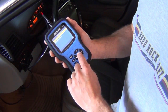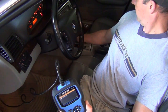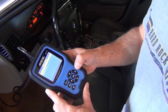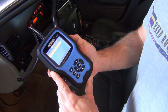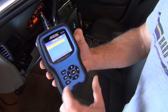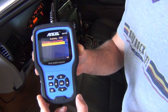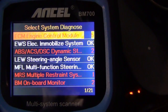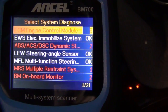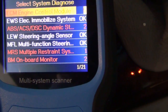We're going to do basic functions and let that communicate. Let me turn the blower off so I'm not draining the battery — I do have a battery charger set up. We're going to do a system scan and it's going to go through each control module. You can see my engine control module has five codes and it's reading the EGS right now at 5%. That took about less than two minutes to scan the whole car — that's fast. They really do mean a multi-system scanner. There's my engine computer — it's number one, highlighted, with five codes.